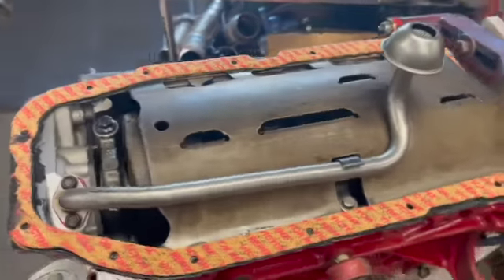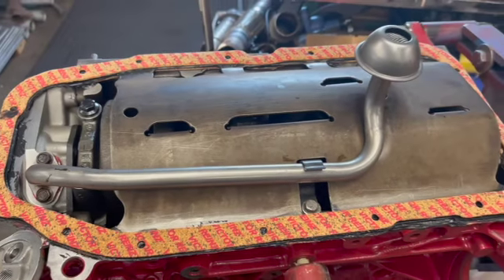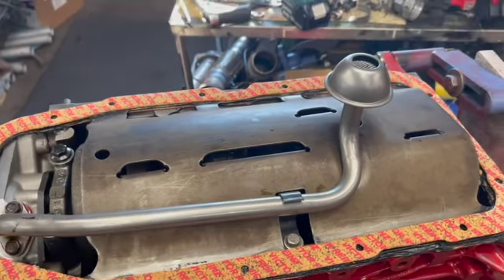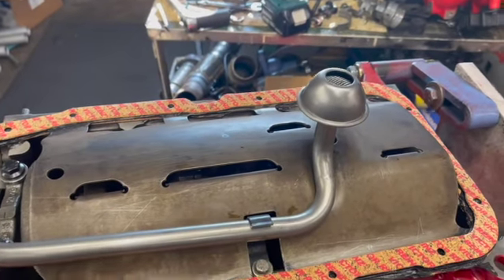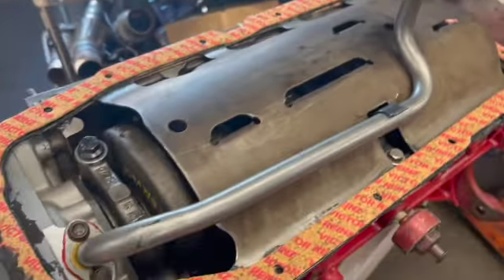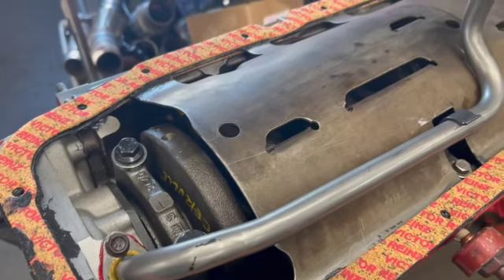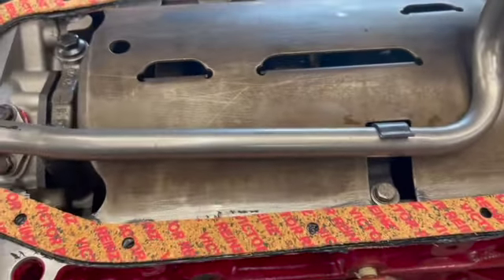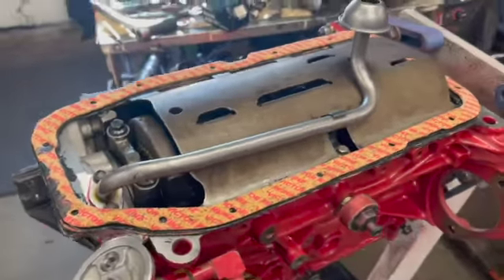This should be the last time you see it with the pan off. I decided to go with the cork and metal oil pan gasket. I've never used it before and figured what the hell. I had good luck with a rubber one but I still see it a little. I never tried this before so I can glue it together and take up any irregularities in the pan rail or in the windage tray. So I'm gonna go with this one.